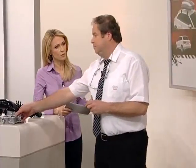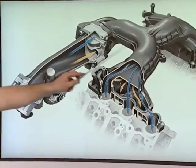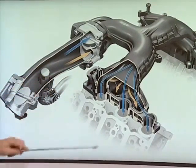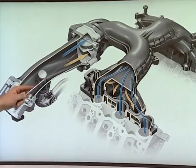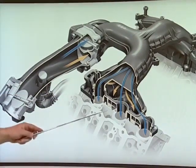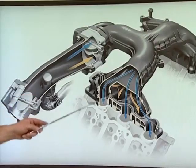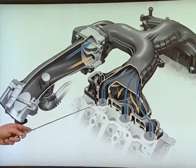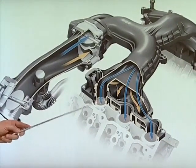Looking at the graphic, inside the intake manifold we can see by way of the parting line that the manifold is split horizontally into an upper part and a lower part. The upper part extends above this swirl flap. The flap replaces the six flaps that were previously used. The swirl flap closes the charging ducts — only then can the three swirls become active. Closing the ducts creates the swirl in the cylinder.